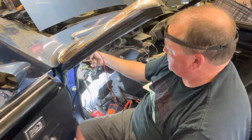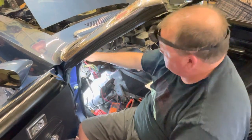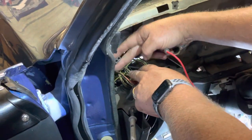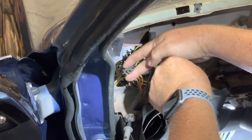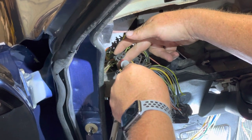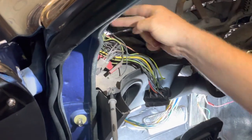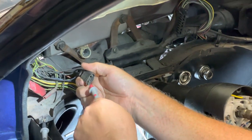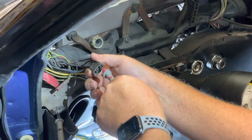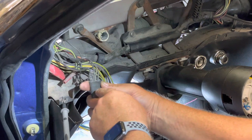I've gone through the wiring all the way down to the fuse box and I'm not seeing anything in there that is causing any problems. This is the connector that goes back to the lights. I'm assuming since the lights are grounded to the chassis in the back that I should get continuity on this — please let me know if I'm wrong. On this plug going back there, I get nothing on the top one, but on this middle one I have continuity.